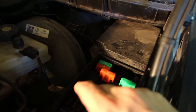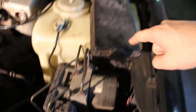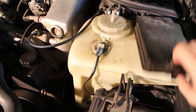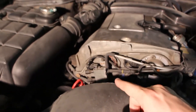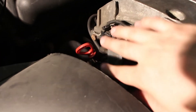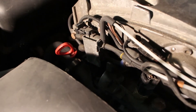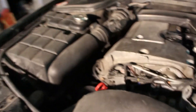I can hear my relay click so I'm fairly sure that's good. I replaced the wiring harness on this car so I know the wiring is all good. The wiring starts down here at a big plug that feeds power from the fuse box, then joins the engine harness which goes underneath the coolant bottle, pops back up, and finally goes down to the front of the engine to the pump. On at least the four-cylinder it's an electric pump — some older cars had a belt-driven pump.